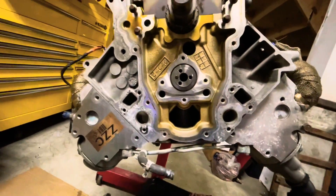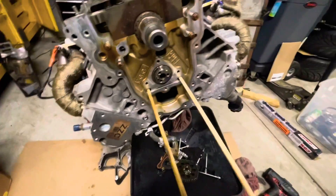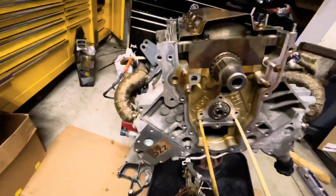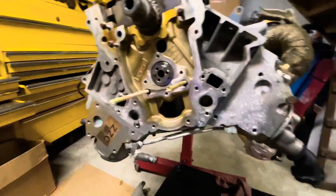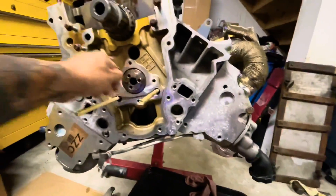Engine's back upside down to make everything easy, and now I'm gonna insert these 5/16 wooden rods into each hole to hold the push rods. I put them in — this one gave me a little problem on this side, probably a little thicker since they're from different stores. One went in like butter, the other went in a little rough, but it's holding. Now we gotta rotate the cam out and take it out.